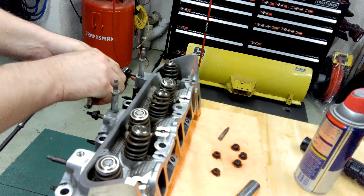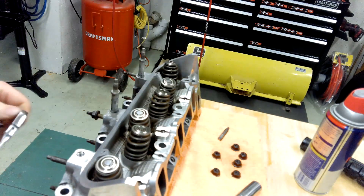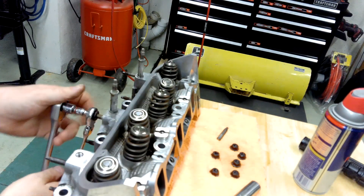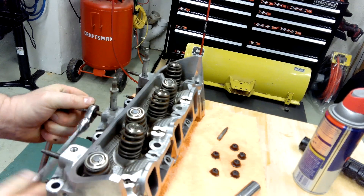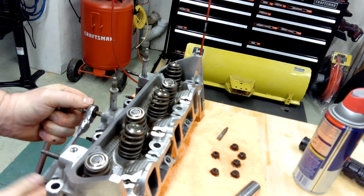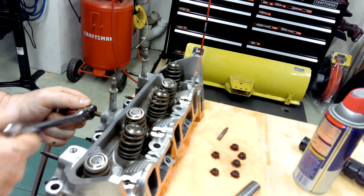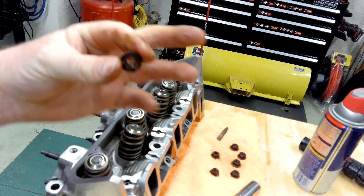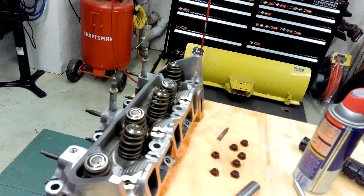Give me back my socket. There's the top one. Now this last middle one — get the wrench on first. A ratcheting wrench with a boxed end will help you achieve this. You don't need an extra-long ratchet, just short throws, because they're only studs with nuts on the exhaust manifold. That's broke free and out she comes. That is a video tip for how to remove the nuts off of exhaust manifold studs.